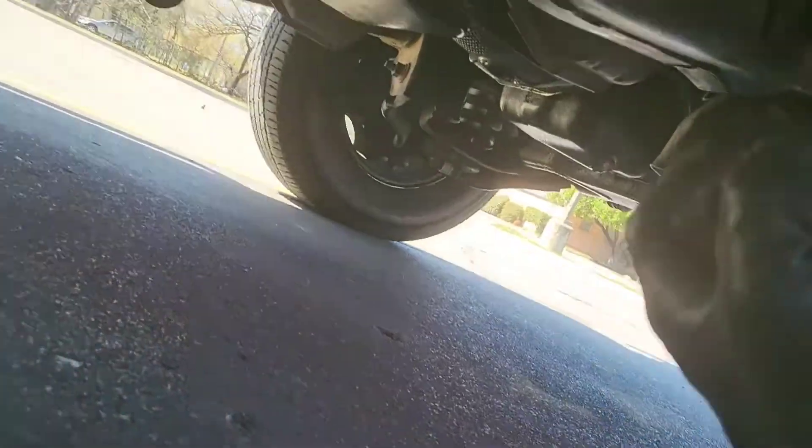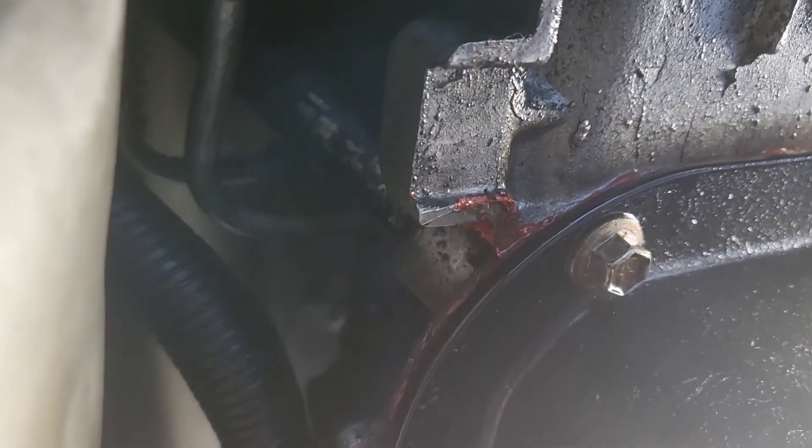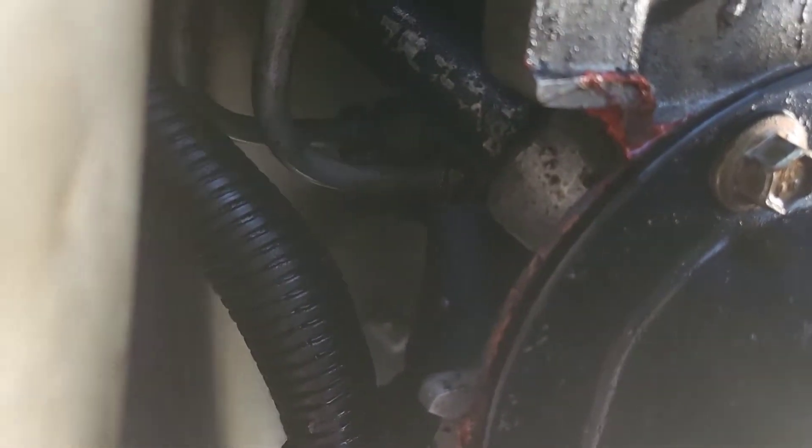What you're gonna need is a three-fourths wrench and a five-eighths wrench, and you're just gonna find those fittings. It's really hot under here. When I was running yesterday I was dripping all that fluid. Three-fourths in the back, five-eighths at the top. I'm still gonna have this little leak right here on the nut — I gotta fix that thread with some plumber's tape, but that's something separate. After I lifted the motor I guess I loosened those lines, so I just had to go back and tighten it — and no more leak, no more trip to the mechanic.